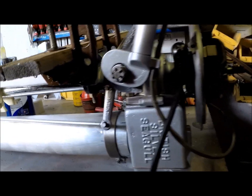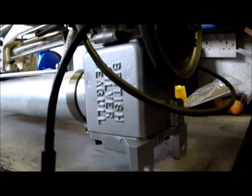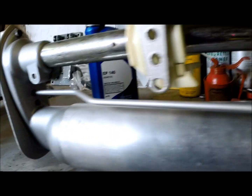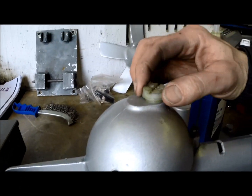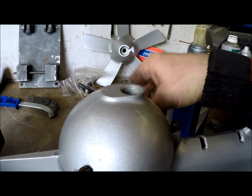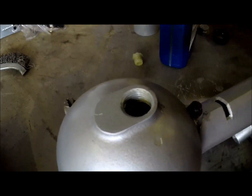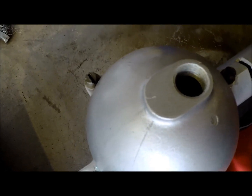I put the seagull on the bench so that I can top the oil up according to the manual. You put it tank side down — we haven't got the tank on at the moment, but it's lying down flat. We need to take the drain plug out, which I've loosened off, and I've read in the manual that you fill it up just below the filler plug level.